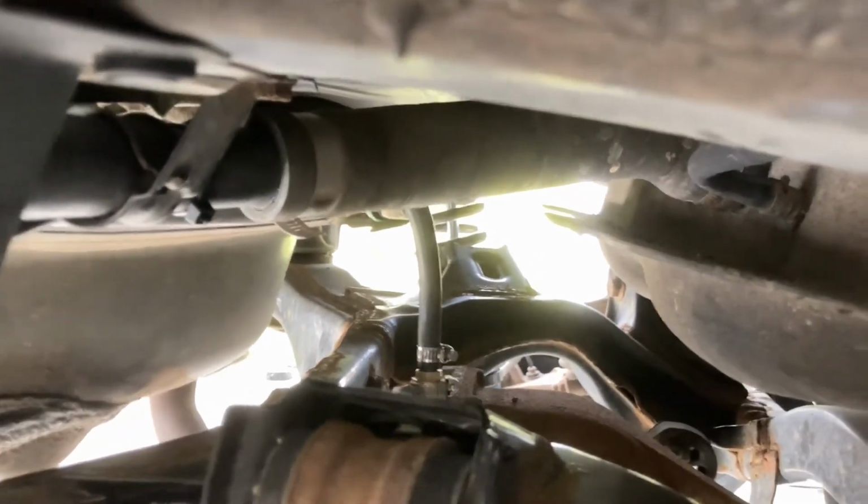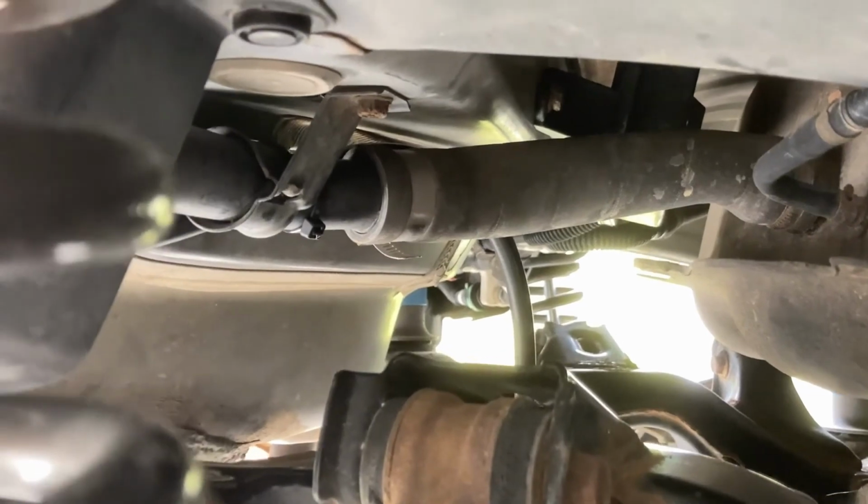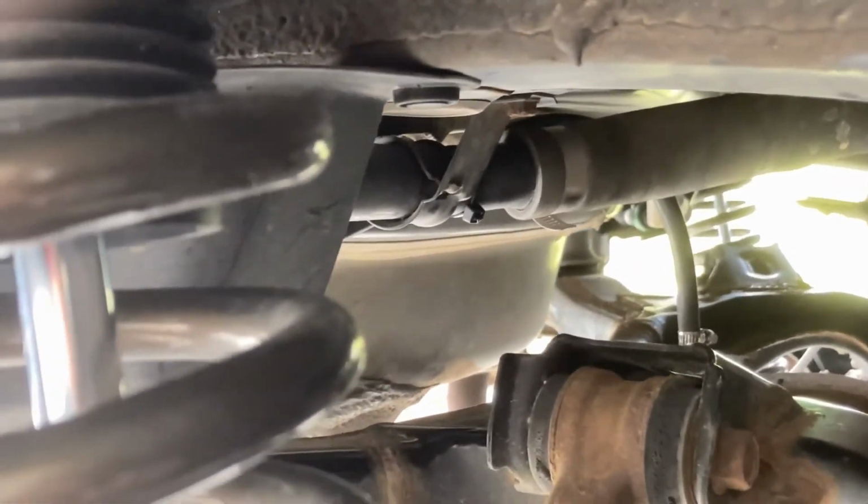I learned by experience that we need to use a 3/8 inner diameter hose and not a 1/4 diameter hose. So I've had to jerry-rig a solution here to make my 1/4 inch hose work. But if you use 3/8 inner diameter hose, you can just hose clamp it to that little lip we just saw. And you can see where I've run it along a fuel hose that is going under the car, just up and out of the way.